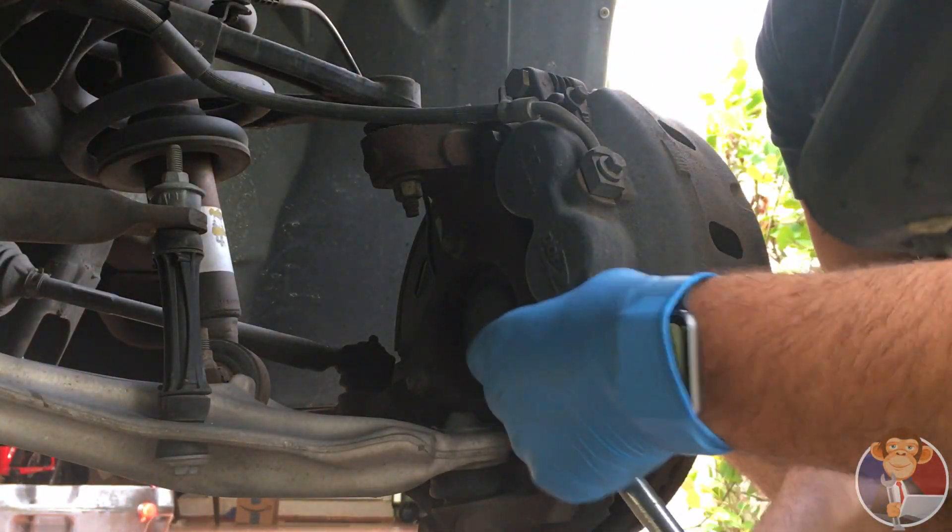Before we start putting the new brake pads on, we're going to replace all the brackets, all the rubbers, everything. Most brake pad kits come with all of that stuff and you should change it. Here's all the hardware — it's just a matter of clipping them in and clipping them off. Same thing with the rubber seals. Then we can lubricate our slides, and they give us some nice lubrication. If your brake pad kit does not come with the hardware, you probably bought a cheap brand. Spend a little more money and it'll come with everything you need.